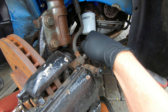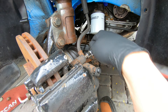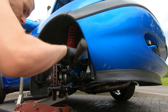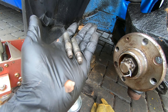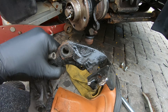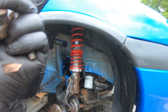You can definitely hear how dry these sliders are — just listen to the squeak. They need a good grease up, so let's get this off and get it sorted. Everything's stripped down now. Yeah, all these sliders are completely dry. The car is actually in good condition — no major corrosion at all — so it just needs a quick clean and then get it all back together.